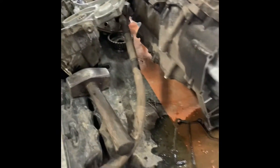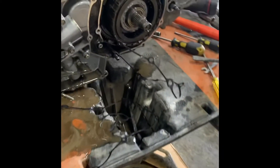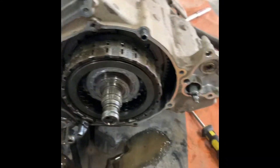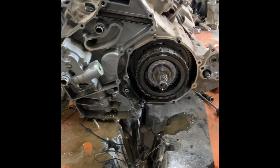I got the back side off — this is the plate right here that goes to the side. The oil filter and all that is in this plate, held on with 10 millimeter bolts. Got it all torn apart. The side parts I took off prior are all here, all 10 millimeter bolts. It looks like the clutch pack right here, and maybe the oil pump — oil pump right here.